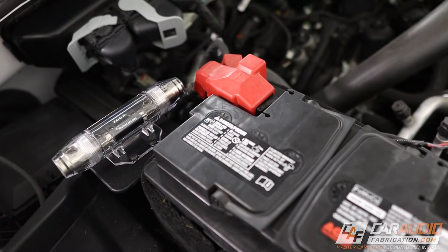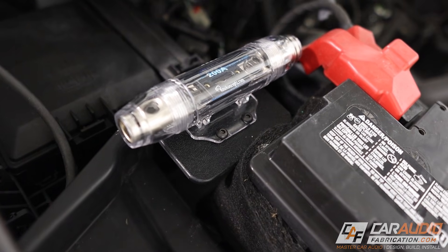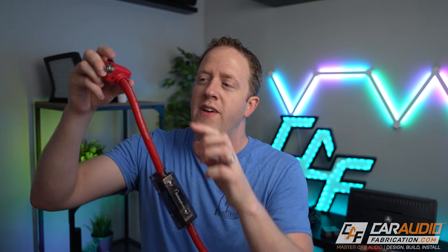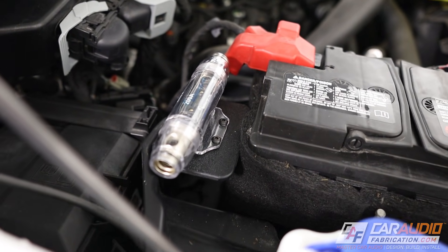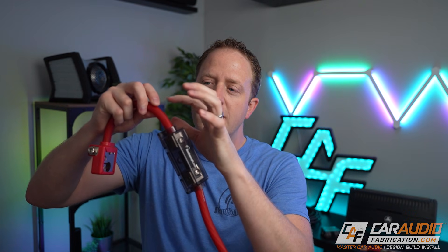For this reason, the better strategy for this length of connection isn't necessarily to keep it under a certain value, but rather to keep it as short as possible. In order to do that, you're going to need to make installation considerations when actually mounting your inline fuse. You're going to want it to be near the battery. One big recommendation is to make sure that this inline fuse is mounted with a bracket — and you want that bracket to be a good, strong design. You don't want it vibrating, because that can weaken the connection over time if the wire is moving freely.